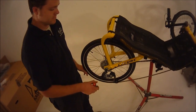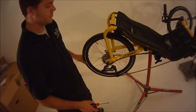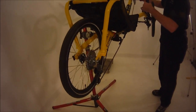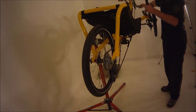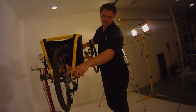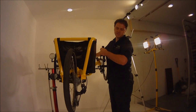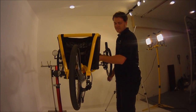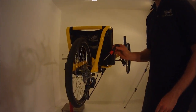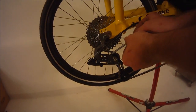I'll show you the symptoms of incorrectly tuned limiter screws. First, as you're pedaling and shifting through gears, if the trike does not allow you to go up into a gear or down into a gear, such as first, right here you can see that I'm trying to put it up into first, but it won't actually allow it. That's a symptom that your low limiter screw is too far in. So what you're going to want to do is loosen this a little bit at a time